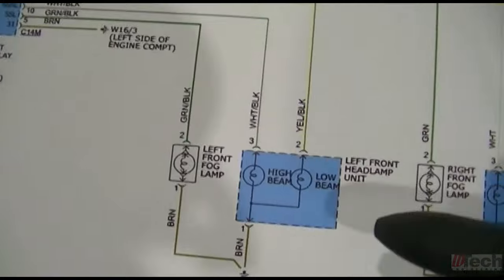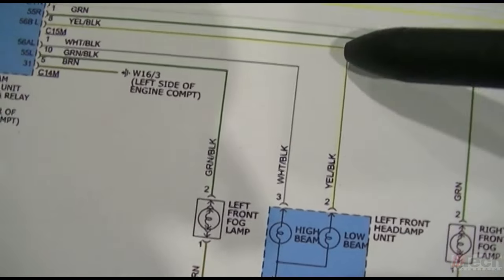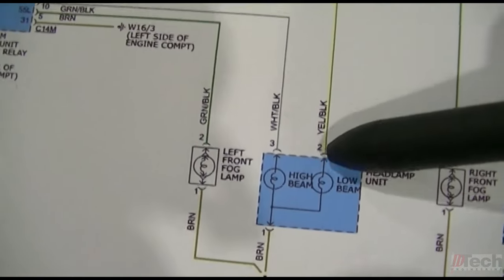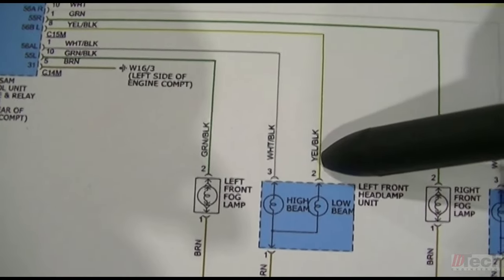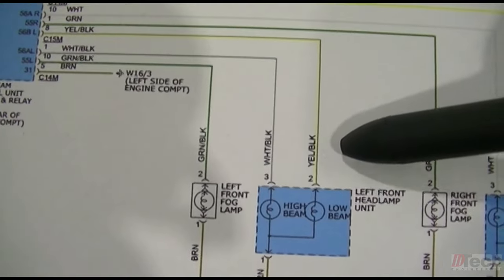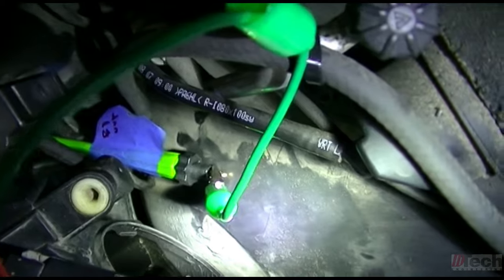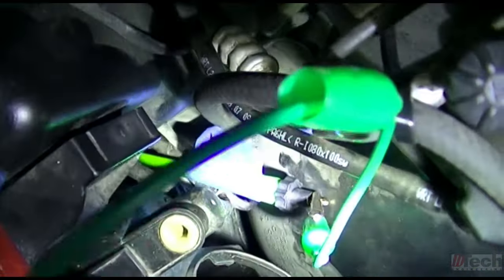Obviously the one I am interested in is going to be this low beam on the left front. This yellow and black wire is going to be your turn on for the low beam, and I will tap in right here at the headlight connector to check to see if we have 12 volts. So I've got my pierce probe on that line. I don't think you'll be able to see the color